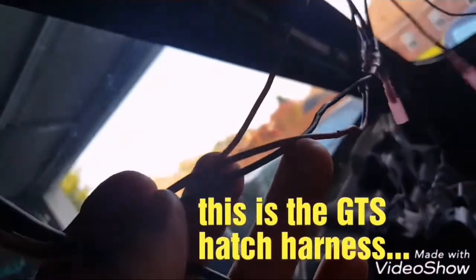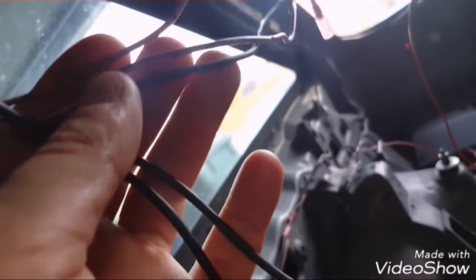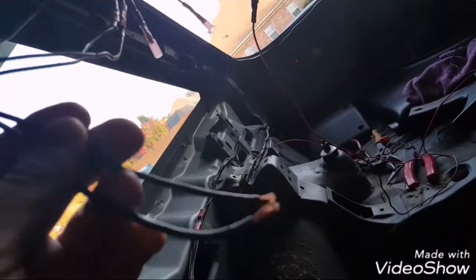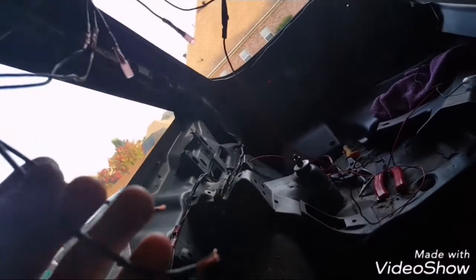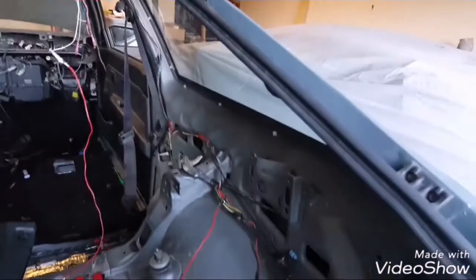It actually doesn't have that in it. It's got just the three wires for the rear window wiper. And it's got, actually, I don't know why, two wires for the rear defrost. And they both work, they both come on whenever you turn the defrost on. So I think I'll just wire one of those up. So the point of this is what wires to tap into in order to get the third brake light to work up here. So what I did was I went over here with the tail light. Actually, I used my old...